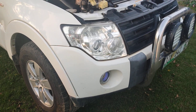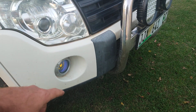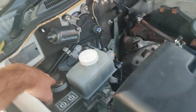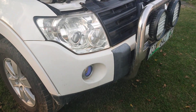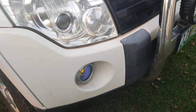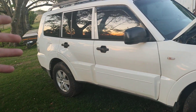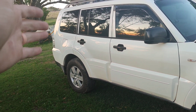There's an easy way to tell the Gen 3 Pajeros apart: if you look at the fog lights of the Gen 3 Pajero and they are trapezoidal, that's the early Gen 3 — they did not have this specific unit. The later Gen 3s had rounder bumpers with round fog lights at the bottom. At the back, the early Gen 3s had almost like a framework for the back lights, while the later Gen 3s had flat plastic back brake lights similar to the Gen 4s.